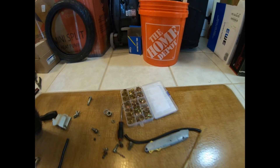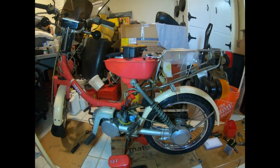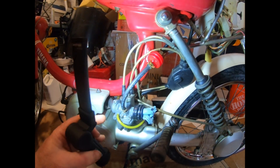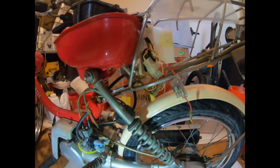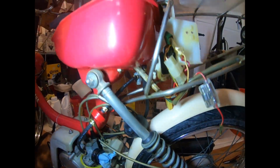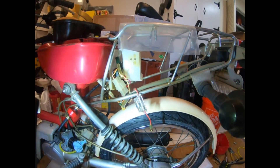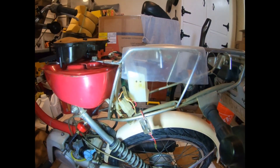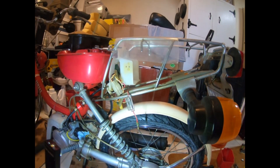I like these — they're nice and tight once they go on, a lot of tension. So I'm putting those on the fuel and oil lines. To go over what we've done so far: got the carb installed, got the oil feed line, got the fuel line, got a little filter installed, got the tank installed, got the carrier rack installed. A lot of the wiring connections were oil soaked — not sure how that happened — but had to clean those up. We're ready to install the battery.